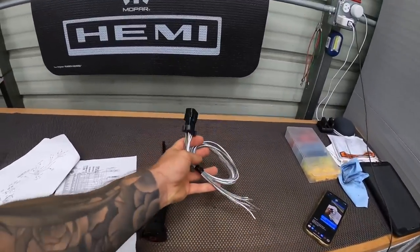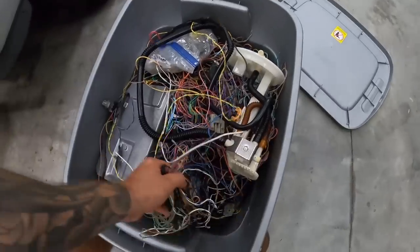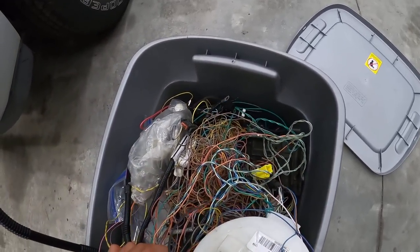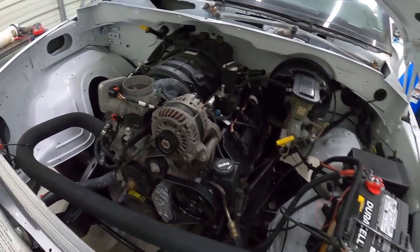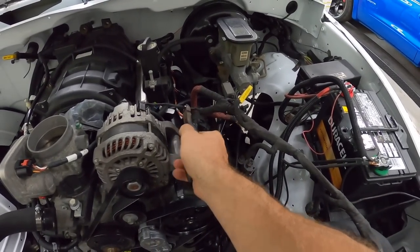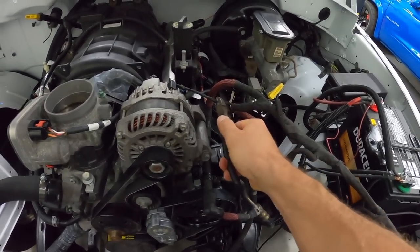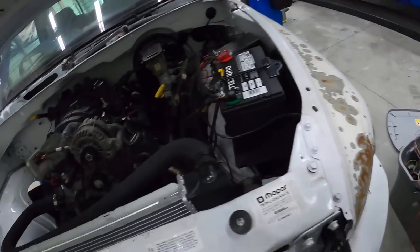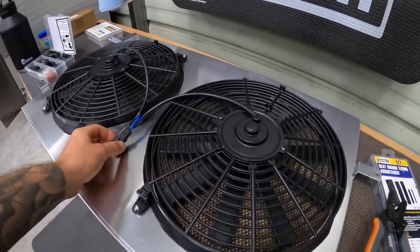I've got a diode, the Holley wiring diagram, and I'm going to find the alternator connector pigtail from my spare harnesses — this stuff always comes in handy. A lot of connectors are the same; this one is essentially the same as a fuel injector clip. I snipped the pigtail from the spare harness and now I've got what I need. For the fans, I took off the cheap non-waterproof connectors they came with and I'm replacing them with Deutsch connectors.